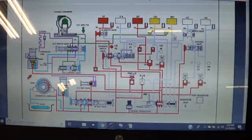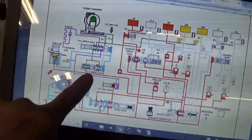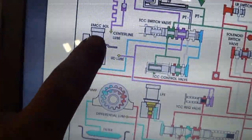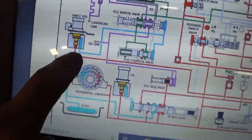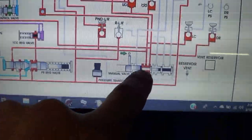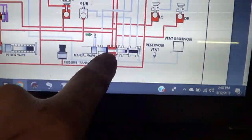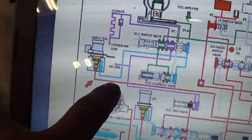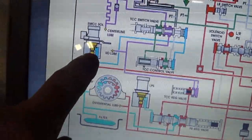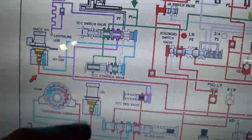Taking a look at the oil schematic, which shows how the valves, solenoids, and clutch packs are used in the transmission. You have a torque converter clutch control valve, a torque converter clutch switch valve, and the EMCC solenoid — EMCC stands for Electrically Modulated Converter Clutch. Following the red, this solenoid is provided with pressure from the manual valve only in drive, so our problem only happens in drive. When this solenoid switches on, the light blue pressure comes over and strokes these valves, causing the torque converter clutch to engage.